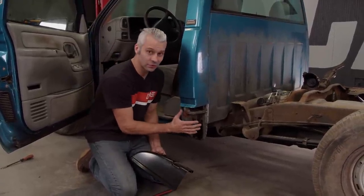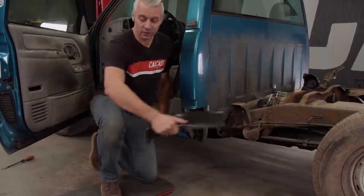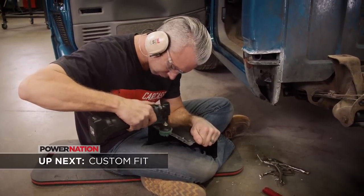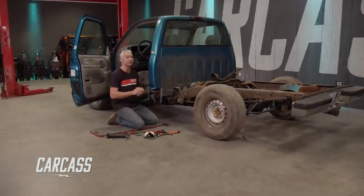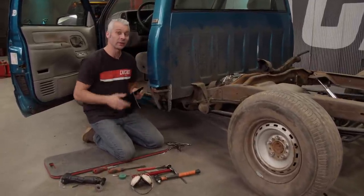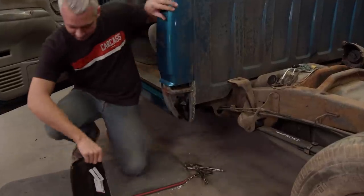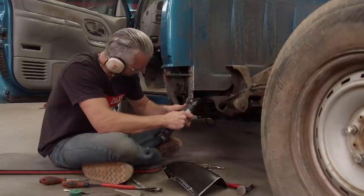As we test fit it onto the truck, we can get it to fit perfectly. We'll head over to the bench, cut it down to fit, and get this thing welded on the truck. The panel's in, test fit's done, and it's all prepped and ready to weld. To get this prepped and ready for installation, we're going to punch a series of holes in the two flanges, take the E-coating off the panel, and take the paint off the truck. We're using our pneumatic Matco Tools hole punch — it makes short work of projects like this. Then we'll start prepping the body by removing the paint so we can get ready to weld.